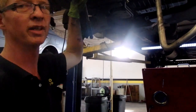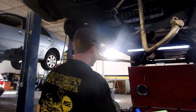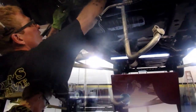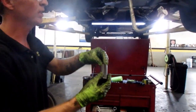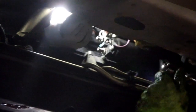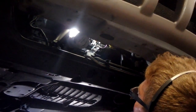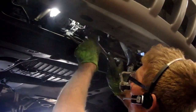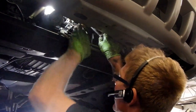I'll pick all that up later. Make sure new one. Stretch out. Let's put it in my socket. Might give me a little bit more reach. I've got it started. And like I say, it's right up above the starter. The wire's in the way. To do that, you'd have to pull that bottom cover off if you're dealing with the oil pressure switch, if it was leaking.